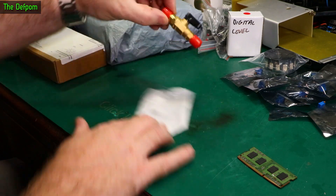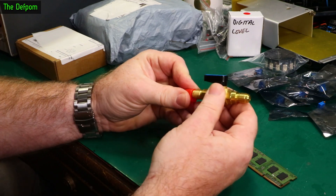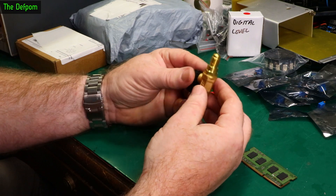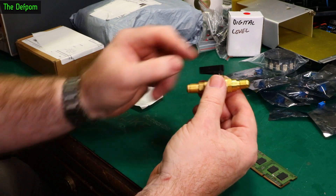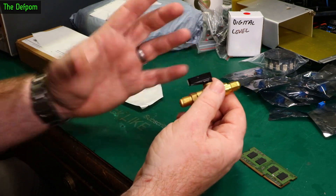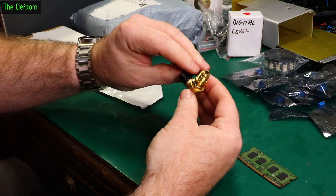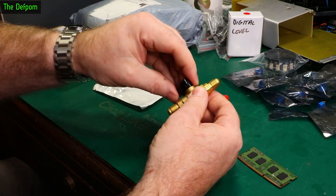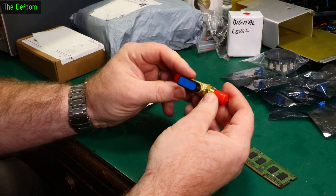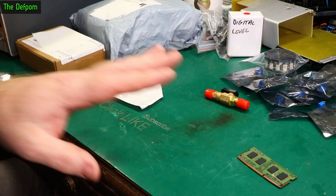I've been playing with my car's air conditioning system because it's been misbehaving. I've been doing a few things with it and I bought a gauge set. There are different gauge sets you can get, and some have what's called a Schrader terminal on them, some don't — mine don't. I've also got some other stuff which has connections that are screwed together — screw connections. I don't actually have a way of just closing the hoses off to keep them clean. You don't want them open to the atmosphere sitting around for a year or two between uses. So I thought I'd get one of these little valves — I can screw the hoses onto this and it'll just keep it a closed circuit, so you don't get any dust and stuff into the actual hoses and fittings. I've done a video on the car, so you'll see that at some point — I haven't actually finished it yet, but I've got some stuff in progress.